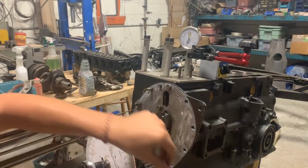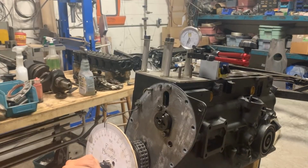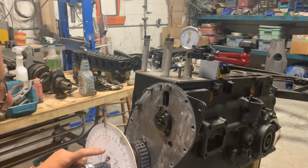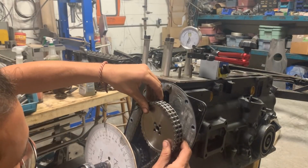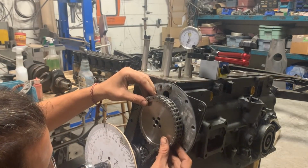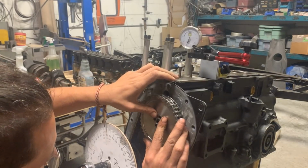Okay, so now our gear is removed. Now, without touching the camshaft, we're going to turn our crank to 110 after top dead center. Which is right here. Now, in this position of the crank, and without moving the cam, hopefully, let's try and attach them again. So now, of course, the holes won't match, so we need to adjust the teeth. One more tooth, I believe. Somewhere there.